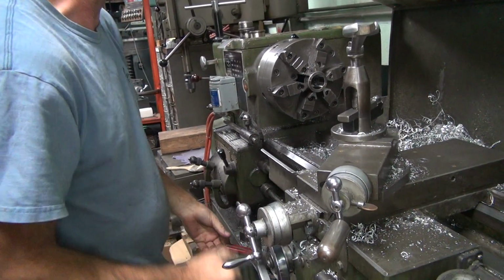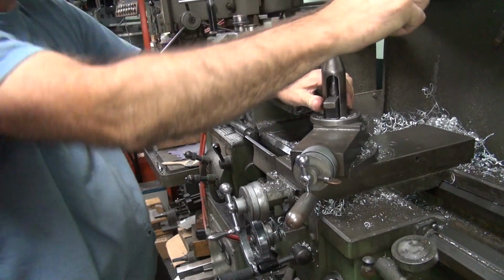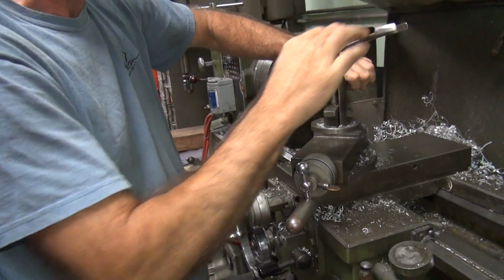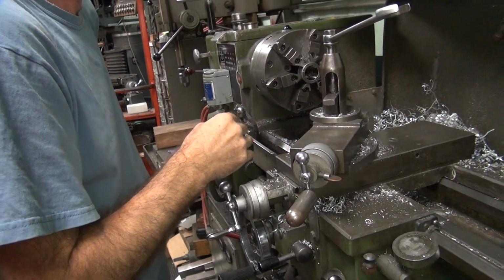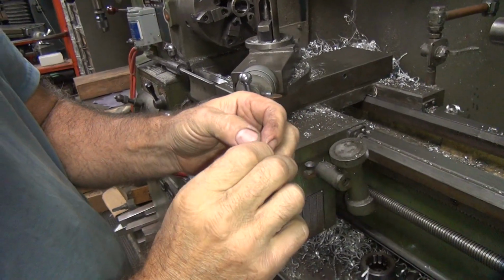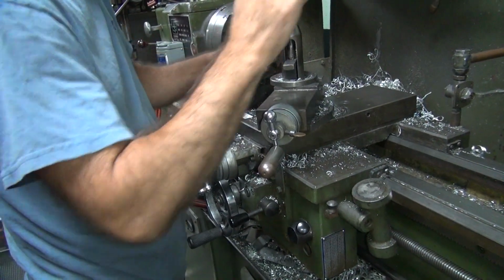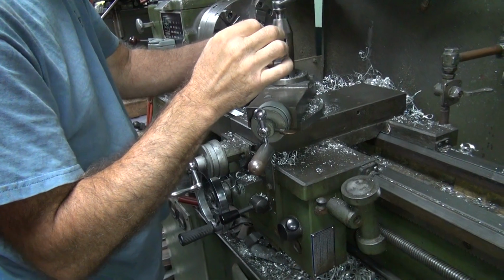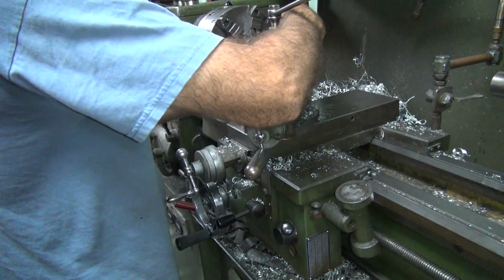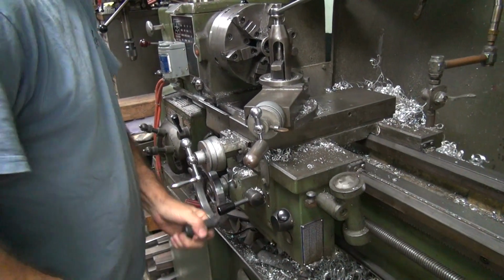Interrupted cut too? I don't think it looks real good. So what bit are we gonna burn through? A few of them. Sounds like you've done this before. I'm thinking that this side right over here looks like a perfect candidate to be used. It's already broken and screwed up. That means that'll be a great cutting surface. One thing about carbide, it'll burn through anything, just about. It just takes heat and pressure.